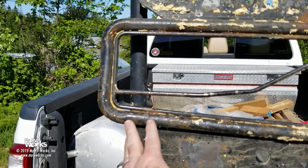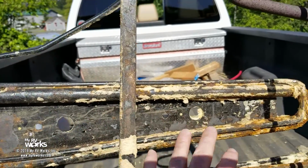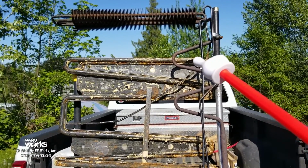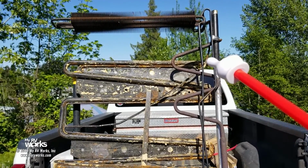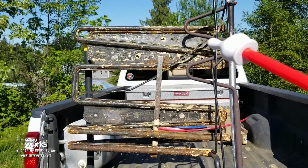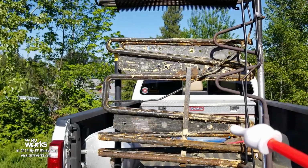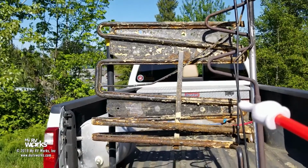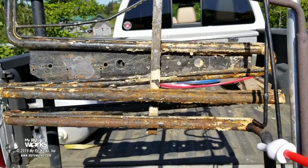And then we're going to work our way back down to the high temperature vaporizer. This point here would be about 15 degrees. Right in this area is where that pressure drop takes place. So we're talking about pressure. At this point, the ammonia is at about 14 pounds of pressure. By the time it gets down here, it's about 40 pounds of pressure. So the ammonia built up pressure. The hydrogen pressure decreased, the ammonia pressure increased. It absorbed a lot of heat, and it started out at minus 28 or colder, maybe down to minus 100. I've even read that it can get down to minus 122 up in there. By the time it gets down to here, it's closer to 15 degrees. Now, then it makes an immediate drop.